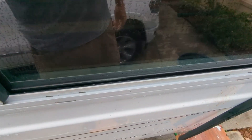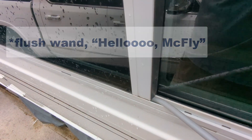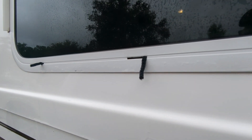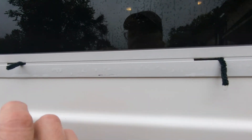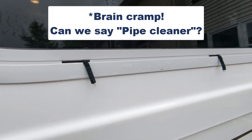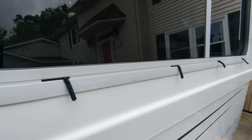The track's really clean now — much cleaner, and all the junk stopped coming out. I put the hot water flush tube right here, kept it really slow so it doesn't overflow inside, and all that junk came out the weep holes — it seemed to work really good. I cleaned real good inside the inner track. Now with the bottle brushes in the weep holes, it's pulling out the excess water that will not come out easily without a wicking device, whether it's string, parachute cord, or whatever. These little bottle brushes work really well. It's all nice and clean and these will dry up as long as it doesn't rain again, and that will keep mildew down under those rubber strips.